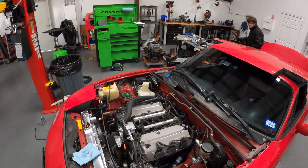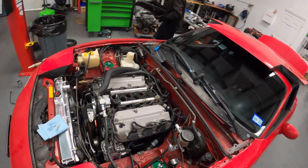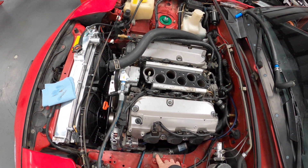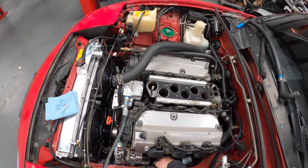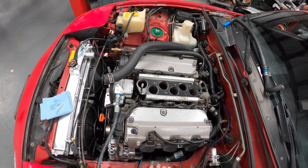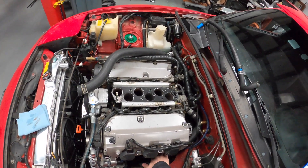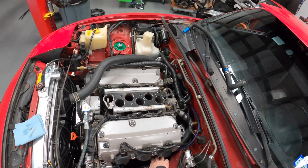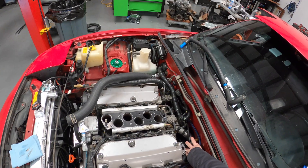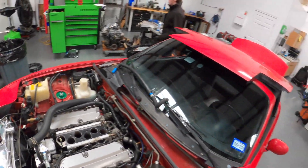Since pretty much all the wiring was done as of yesterday, I went ahead and took care of these coolant hoses. On this side, using the stock Miata side pipe, I bent the bracket upward a little bit and now it is very tight up against here. I drilled and tapped these two for M6x1 so this hose nicely fits over here securely. I will be putting some heat shielding against this as well as some anti-chafing material like a piece of rubber.